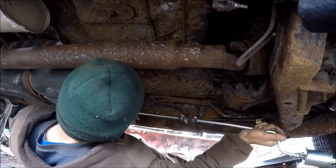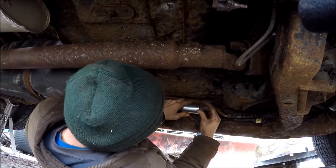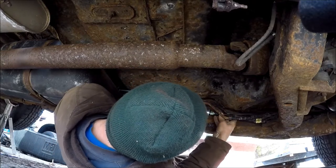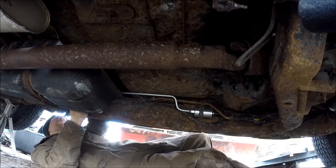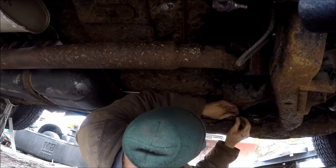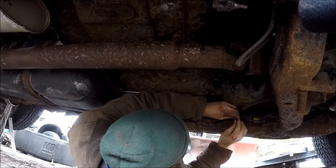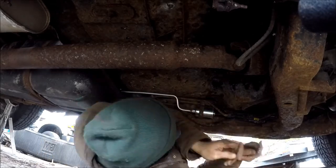Got the line all cut and trimmed, put together with a hose — did it on the bench. Got three fuel injection clamps on here. Go ahead and slide it into the frame and slide the fuel filter up into the bracket, just like that. Get it lined up. Take the plastic line here in the front and click that back on — it just goes a little plastic clip and an O-ring, just goes click right on there like that, nice and secure. Go ahead and get the back line put together the same way — it just clicks on. Grab some zip ties and zip tie this whole mess together because the return line is pretty rusty. I had this all zip tied together before so I'm just going to go ahead and zip tie it together again. It holds the lines in place good enough. Throw a couple zip ties on here — one in the back to keep it all snug so it doesn't flop around and rattle. Two in the front, one in the back. Grab the pliers and trim off the tails.